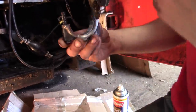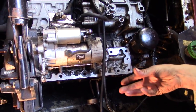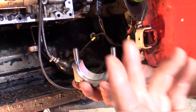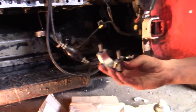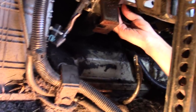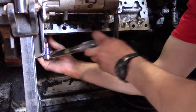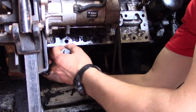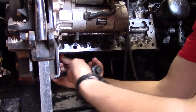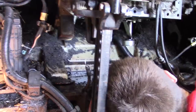I got the PlastiGauge all taken off, cleaned it all. I popped the piston back up enough so I could re-clean the crank journal. I oiled everything, so now we've got oil on here. For a new install I would use assembly lube, but I'm just going to use engine oil because these bearings are pre-worn, so it'll be fine. I'm going to torque it — just snug them both up before I do. 36 foot-pounds. Everything's in order.